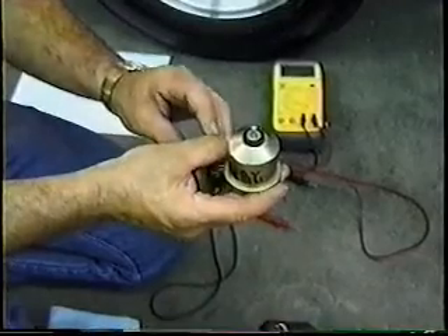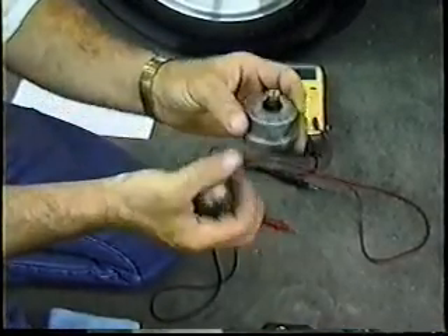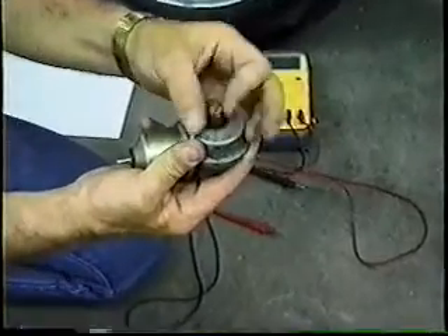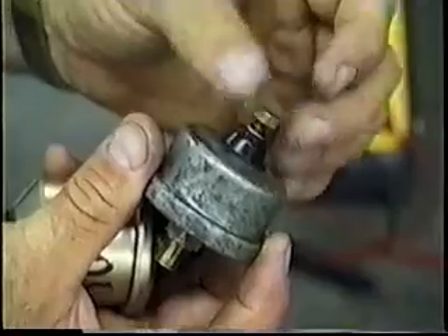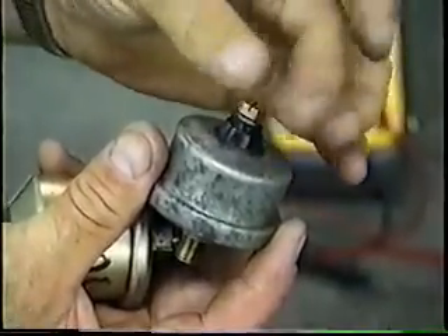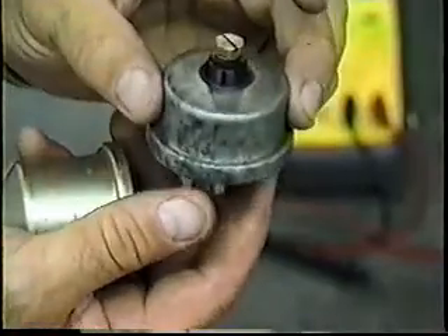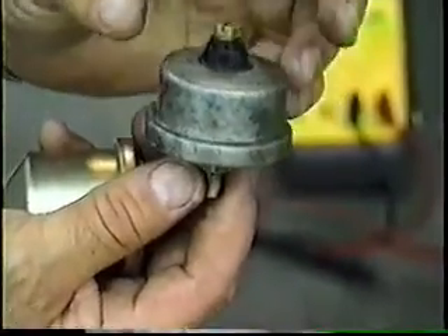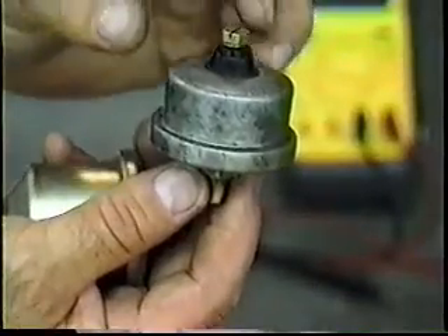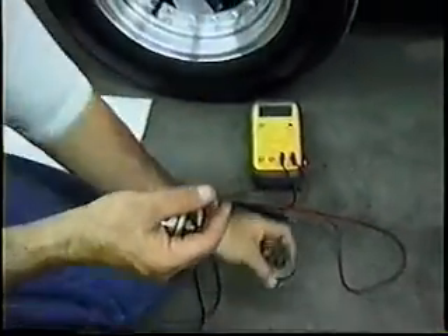For those of you who had low oil pressure readings in your Z's, that's very normal. This is the early Roadster unit — easy to tell because it has a little 10 millimeter screw on the head that held the wire on, and this made your gauge read a lot higher. You can order this from Nissan — just ask for the Roadster SPL and SRL 311 oil pressure sending unit — and those will make your gauges read higher. But you can only use that style on a seven pin airflow meter; it will not work with a five pin.